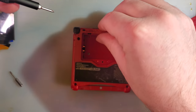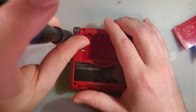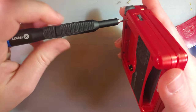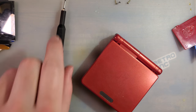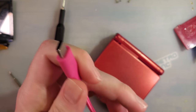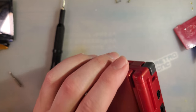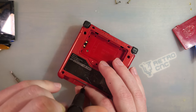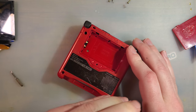There's a new one by Roarsaurus that includes two resistors on the CC lines for USB-C, which means you can use it on the USB Type-C host. That is, if both sides of your connector look like this, then it'll charge with this. Or with Roarsaurus' version, whereas the one that I did a video on only works on USB Type-A hosts.